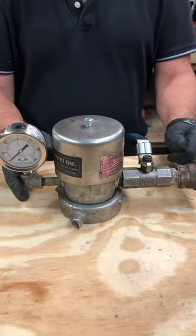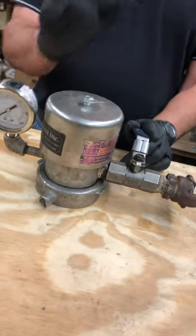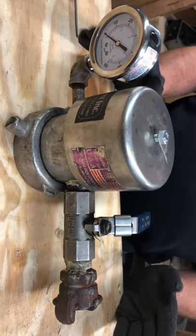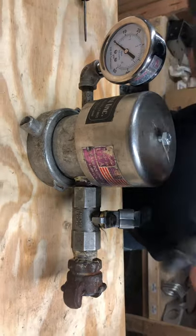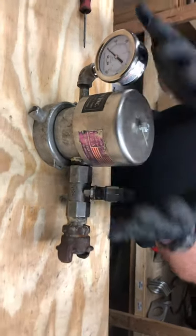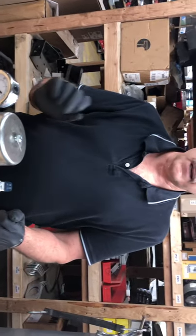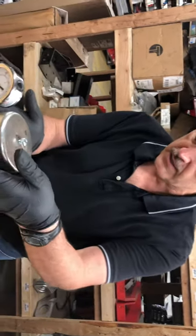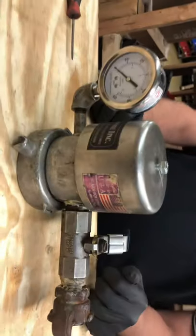Right off the bat, let's look at this: the pressure gauge, the bonnet, and the air inlet. The first thing you need to remember is this — if you're losing air from your tractor or your trailer while you're airing up, it can only be coming from a couple places: this valve, the dome lid gasket, or the washout caps, or the pressure valve. If you think it's coming out of this valve, you need to listen for air coming out from underneath this bonnet, and I'm going to explain that to you.